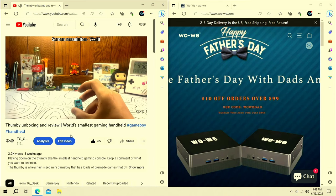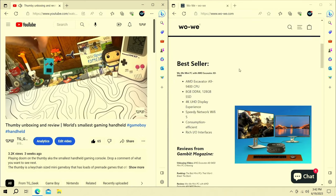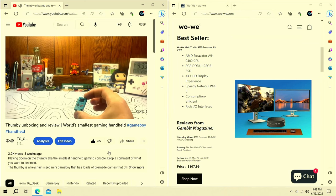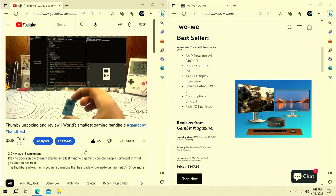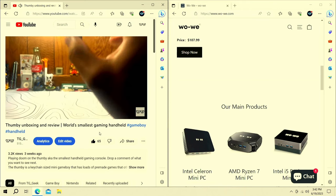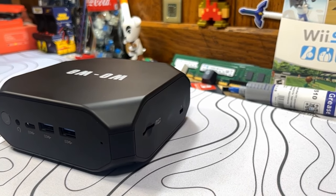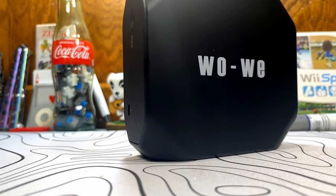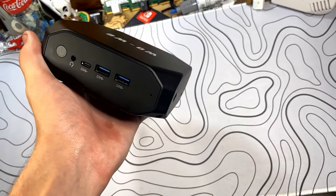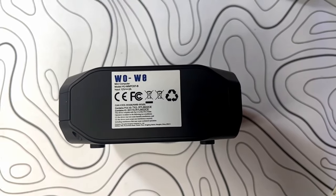You can definitely have a video going while you're over here shopping or typing up an email. In my past review, I said I really liked the concept of WoWi's budget mini PC — specifically the Celeron N4020 — but I wished it had just a little more power and just a little more options. Personally, I feel like this mini PC has hit that target. It's actively cooled so it'll never thermal throttle, and even though it's only a two-core processor, it can boost pretty high to around 3GHz. Considering the age of this CPU, it's actually still pretty usable. This is a perfect mini PC to leave hooked up to my monitor next to my main PC — to upload YouTube videos, check emails, or browse the web. With how power-efficient these are, they're a great option. The AMD A9 Excavator gives more than enough power for any daily task.